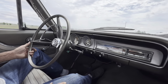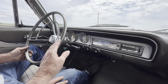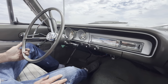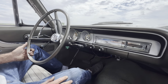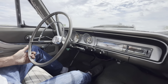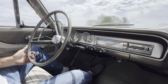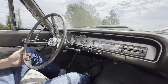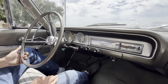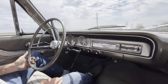A little bit of shimmy. I think it's because them brakes are sticking. Tires? The brakes are sticking on the front. I bet if we jacked the front end of it up, tried to roll that tire, you couldn't turn it. And you loosen off on that master cylinder, if you can turn it, it's the master cylinder. But if you still can't turn it with the brake master cylinder loosened, it's gonna be the hoses going to the front brakes.